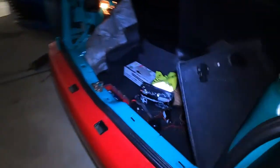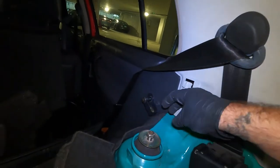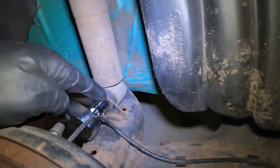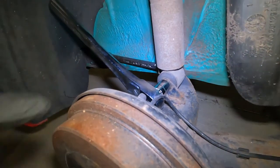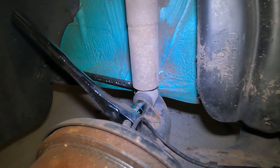Welcome to the garage. So as you can see, up top it's the same as a Mark II, Mark III nut. I've already taken off the piece on top with a nut. You've got another nut and bushing. This is the different part — right here you've got a 16 on the outside and a 17 on the inside. And that's it — one bolt in the back, nut up top, pull it out. I've already got the driver side done. I'm going to go ahead and pull this out.